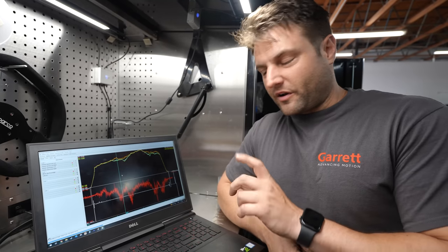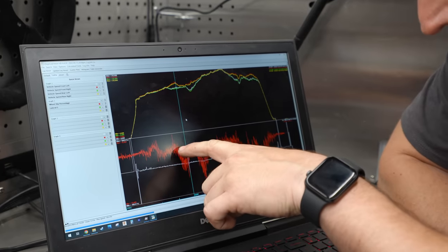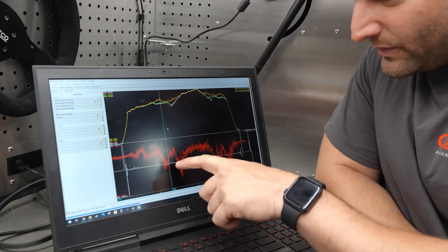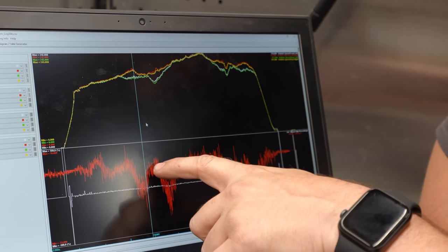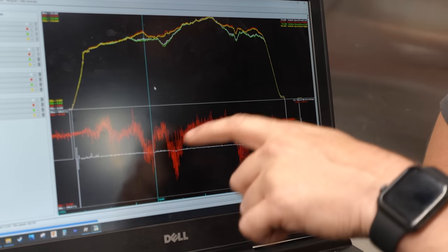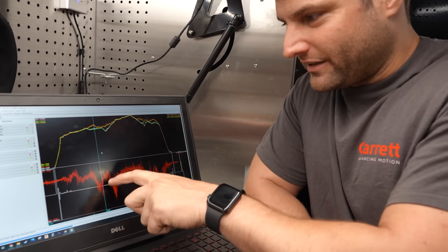One more thing we were just talking about off camera is wheel slip and all that, and I realized that because both front and rears are slipping the same, wheel slip is virtually nominal. But this red line here, this is lateral G, so it's how hard you're being pulled to the side. This confirms the wheel speed things, because as soon as I start turning hard, tires start to separate in speeds, and then with less of a turn, you see it's returning back to normal, and then a harder turn again splits the wheel speeds up more. So these do kind of mimic each other. The harder or more aggressive the turn, the more correlation. It's almost like, you guys that know calculus know that this is like a rate of change.